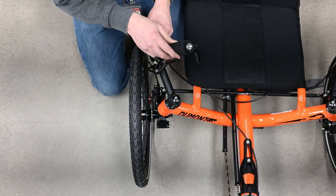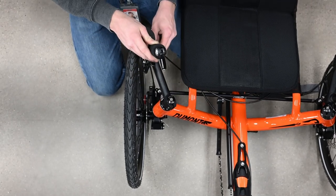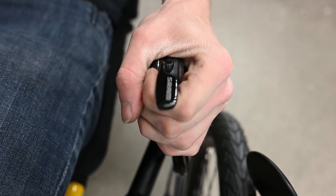In addition to seat angle and adjustable boom, the Cat Trike also features adjustable direct steering handlebars. The direct steer two-piece handlebars on the Dumont have three degrees of adjustment — you can move them in and out, forward or backwards, and adjust the angle for maximum comfort. Ideally your hands will fall naturally to your side and reach the handlebars. It's worth taking the time to get them adjusted for your perfect fit — it makes long rides much nicer.